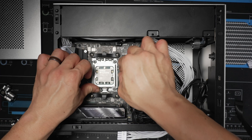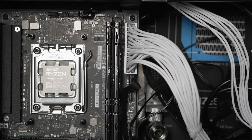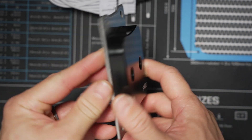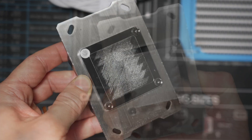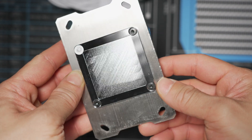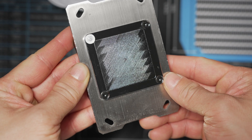So what's in this? We have the Ryzen 7700X — I tested this chip fairly extensively with the T1 Reference Edition and I've been really impressed with it. The block over the CPU is the Summit Pro block, a specific AM4/AM5 version. It's pretty heavy, a solid chunk, nickel-plated copper cold plate. Interestingly, the cold plate is not machined smooth — there's some texture here. We'll see just how well this works out shortly.